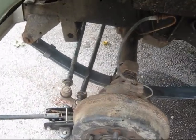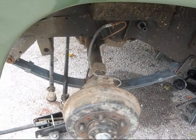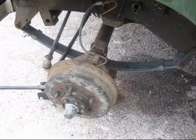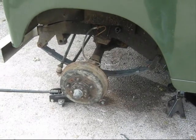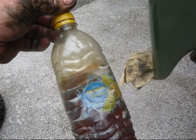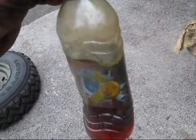Self-explanatory — there are little plugs in the bottom. What I'm going to do is pull the plugs out, drain them all, and then re-top up with fresh oil. They don't seem to be leaking, which is classic — if they don't seem to be leaking, they've got no oil. I'll check the diff as well; I've done the back when I did the rear section. I made a little fill bottle from a bit of plastic tube I had, to fill up the swivels. Used it a few times including for the diff. Never popped out because it was a nice squeezy fit — improvised, but it works.